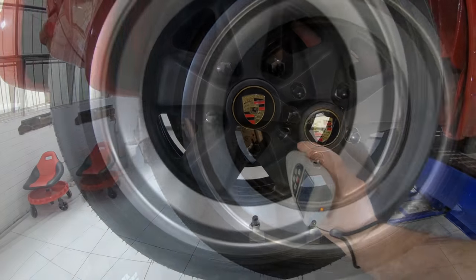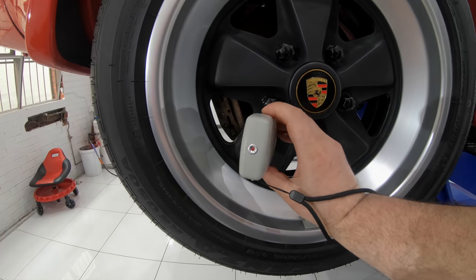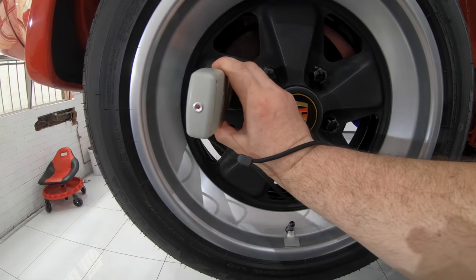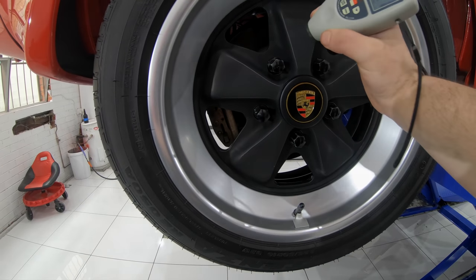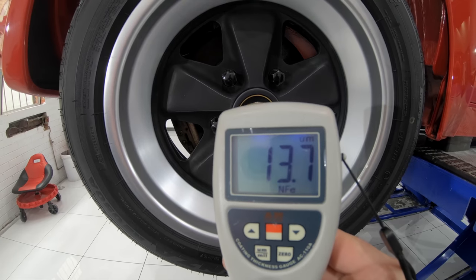After a closer inspection and a measurement of the paint on the rims, where I was getting readings of 10 to 20 microns, which is extremely thin, it immediately put polishing the rims off the table as there simply wasn't enough paint to make it an option. But it also made it quite clear to me that these rims need a decent coating or protection in place if the paint's going to survive on them.